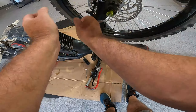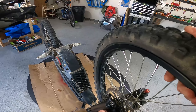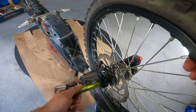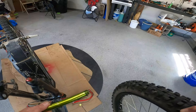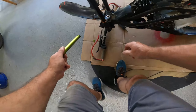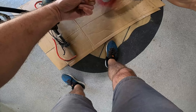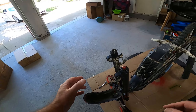Now that the bike is upside down, this cap is typically on the right side of the bike but is now on the left side. Interestingly, instead of tightening clockwise, it actually tightens the opposite way. To loosen this cap, you actually go clockwise — what looks like screwing it in is actually taking it out. It's very strange.